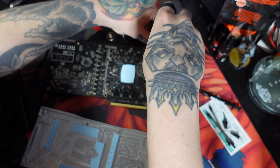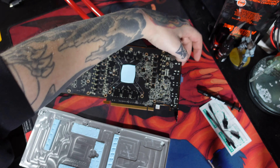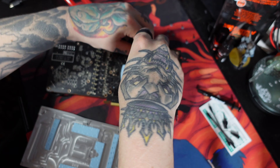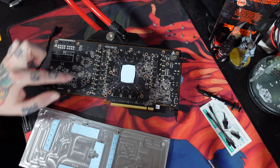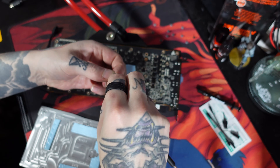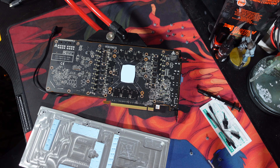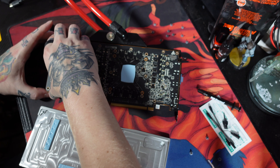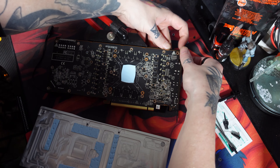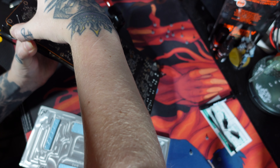If I was cool, I'd have a Gamers Nexus mod mat, but I've been lazy and haven't ordered one. I don't have an actual workbench because the two tubes coming off the top of the water block are still hooked up in my system. We'll look at that later when I install it back on the motherboard. Now we're going to pull the card off and wiggle it so we don't get thermal paste everywhere, as well as not bending the card and ruining any of the thermal pads underneath.